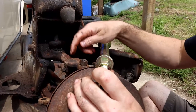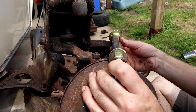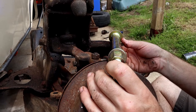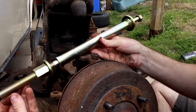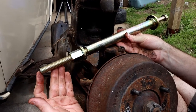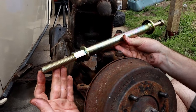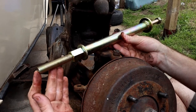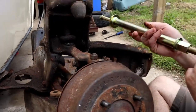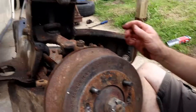The next thing I'm going to do is remove this top suspension arm. To remove that, you really need to compress the rubber up here — the suspension cone — and to do that you need a special tool. On the other side I got all the tool ready to do it, but it didn't fit because I think this is metric and I needed the imperial. But the other thing is I didn't actually need to use it, so I don't know if that means the cones have slackened or something.